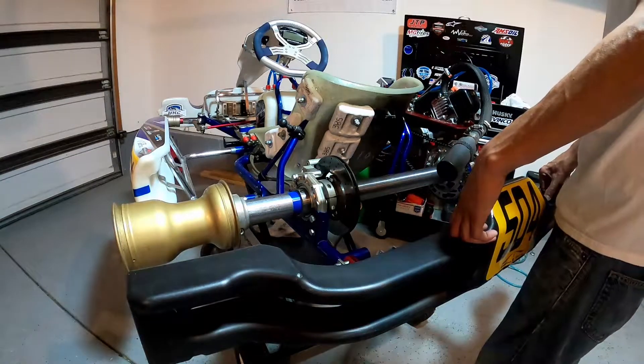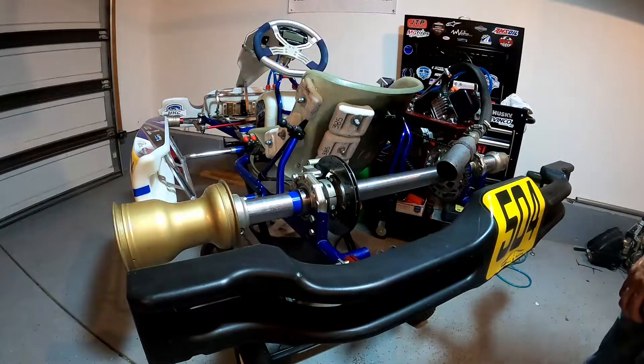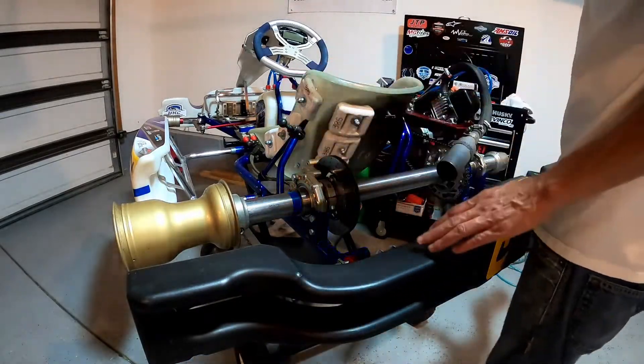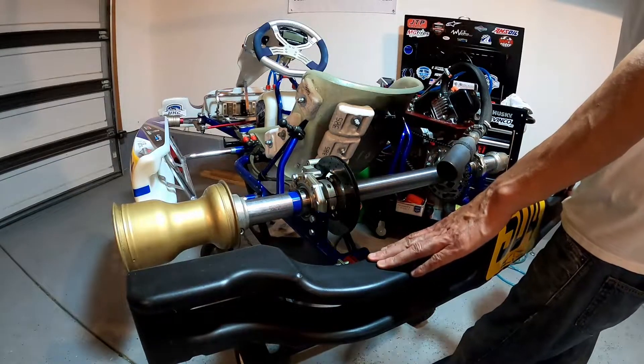On the other side, say you're at a track early in the morning, it's kind of dirty, there's a lot of dust, or you've got an older set of tires or a harder compound tire on — you may want to have a little narrower rear track width just to help get weight off that rear inside wheel when you're cornering.